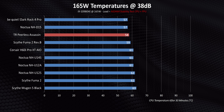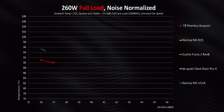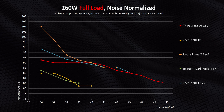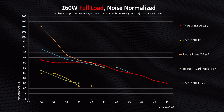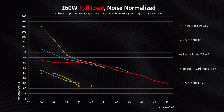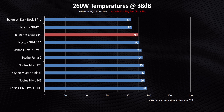I do want to point out one important thing, and this goes for every cooler out there: never keep your fan profiles on your motherboard at auto setting. What that does is completely kneecap every single one of these coolers, because your motherboard will be striving to hit the lowest temperatures possible, and even the Peerless Assassin will get overly loud for the results it gives you. So make sure that you go into those fan curves and optimize for performance and noise levels. What really separates the best of the best from all the rest is that coolers with a larger thermal mass end up winning — or in the U12A's case, finally becoming a lot more competitive. Once the heat rises to almost ridiculous levels, the Peerless Assassin outperforms the Scythe and U12A at quieter fan speeds while matching those two at higher decibel outputs, but it's just nowhere close to the big boys. Overall though, the results are still impressive — hardly anyone will be pushing their processor to output this kind of heat.